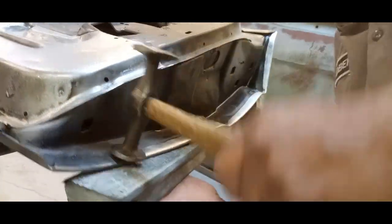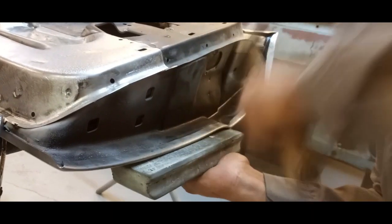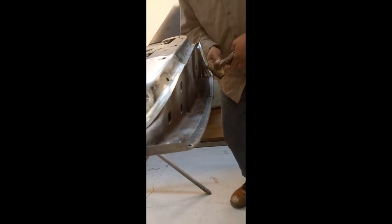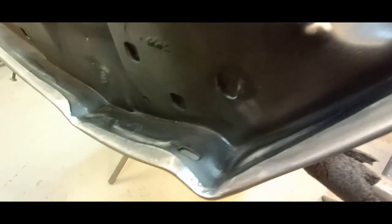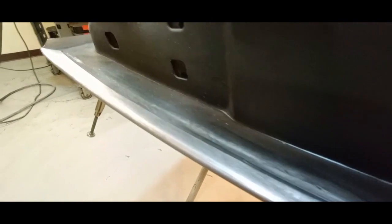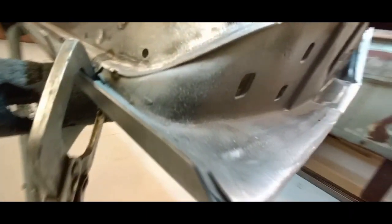I'm finishing it out — I've used about three different body hammers with different faces, and now I'm finishing it off, really crimping that edge down. Take your time, be nice and even all the way down, then just keep repeating until the flange flattens out. I finished it off with the flap wheel, and here's a shot of the finish. I'm really happy with that — now we're ready to move on to the next flange.